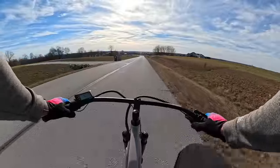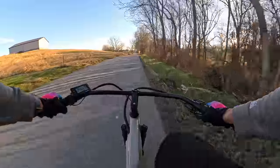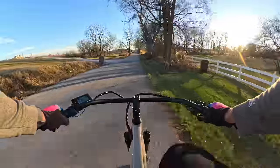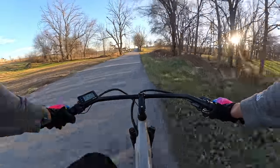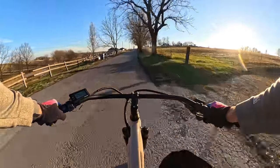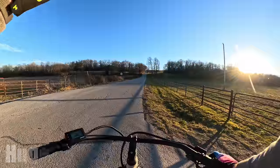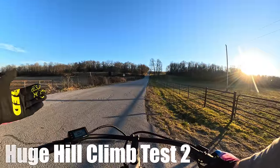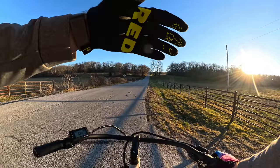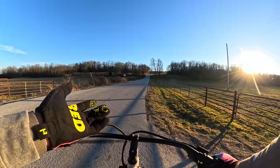Back on the Cafe Cruiser with a full charge — and this thing is even more of a beast fully charged, pushing 800 plus watts. I feel like I'm on a cafe racer, not a cafe cruiser. Heading back to the hill — I've also fixed the derailleur. It fell off on the inside but that was an easy fix, just had to adjust the high-low screw.